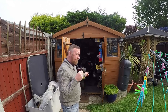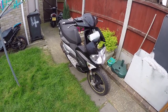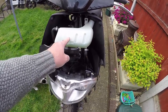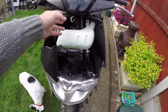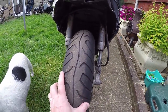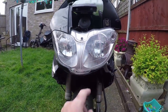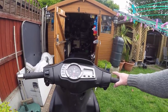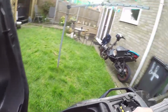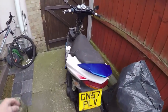Lots of bits and bobs and they are quite fast. And in the corner - Gilera Runner. These are fast bikes, missing pieces obviously. Good to see antifreeze in these - do not put plain water in them. In summer you keep the bike, winter it expands, head goes - now you know why. Front suspension - you can't mess with these. Not bad tyre. Twin bulbs at the front, missing bulb, there's your horn, nice dashes. This has got brake levers, petrol in here. 2T is under the seat, which is here on the Airox.